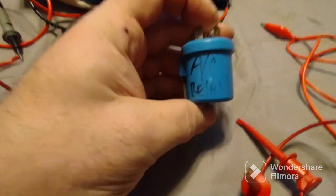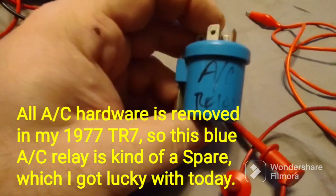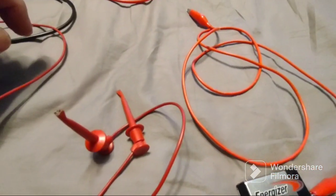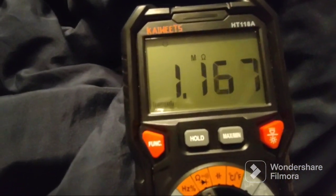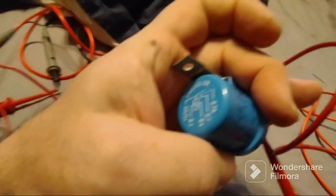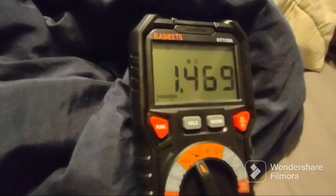This relay was part of my AC system - the AC relay is a blue one, just like the starter relay. Now let's look at the starter relay's coil resistance. I'm connected from pin 85 to 86 and look at this - one megaohm! This coil is an open coil, this is a dead relay. This is why my TR7 was only starting some of the time. I'm going to use my AC relay instead since it's in good condition - this starter relay is a goner.